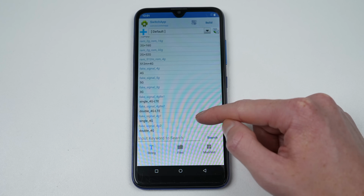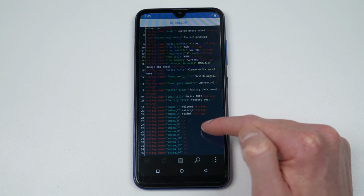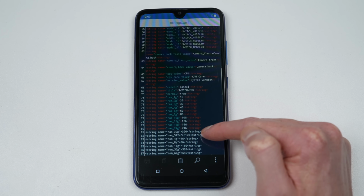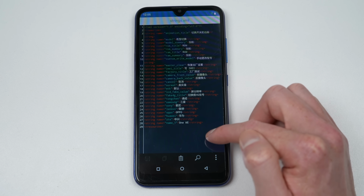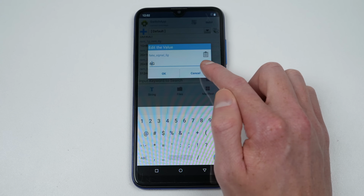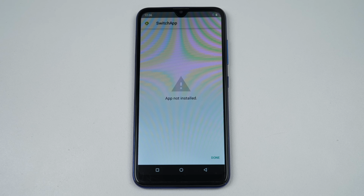That means they've likely stolen a real S22 IMEI number and just written it to this phone. I did find some other code files suggesting Welcome isn't the only brand name they use, but nothing else too interesting. I made my modification and rebuilt the app for installation. It failed as the signatures don't match.